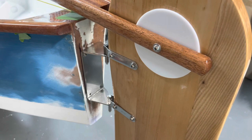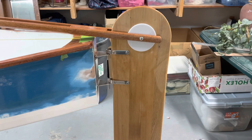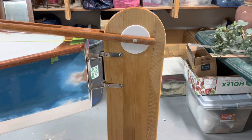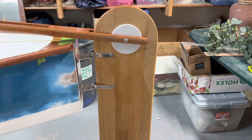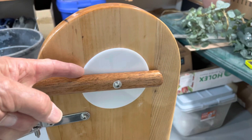I decided to do this for a couple of reasons. You can see how the rudder is displaced from the transom by about two and a half to three inches, so the rudder sits just a little bit aft of the boat. Looking at the setup they have for the pop-up rudder — the setup in the plans actually displaces the rudder from the transom like this — so I'm hoping this will wind up with a good balance of the boat for steering.